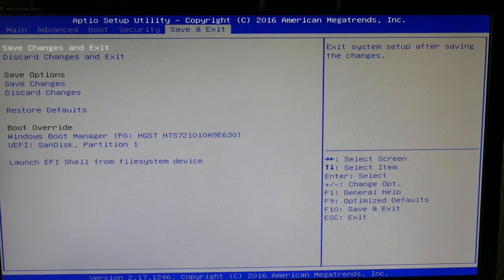As a shout-out, if you find your hard drive is not listed in the BIOS, that could be a sign that your hard drive has gone bad. The next step would be to try to reinstall your operating system — we have a video linked below on how to do that. Sometimes your operating system gets corrupt and your computer can no longer access it, causing a no-bootable device problem.